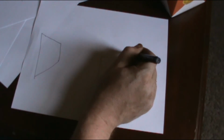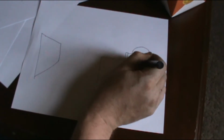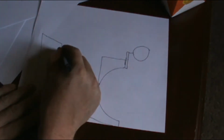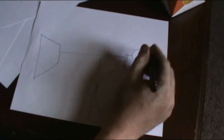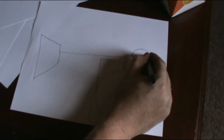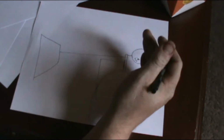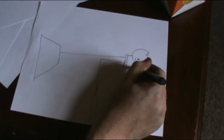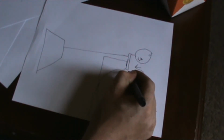Alright, and then you got your dial indicator on it, and you got your needle or your stem going all the way down. I know those didn't line up, but just pretend with me. Take this one first, and then this one second. As you push this down, you're applying force downwards to get it to sit flush here, and you want to hold this as flush as possible.